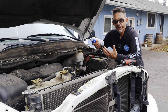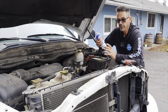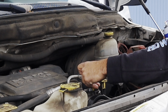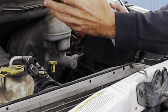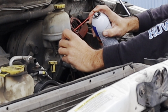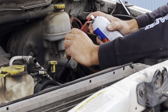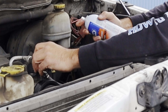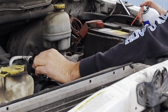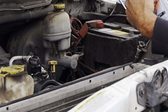Now that the battery is disconnected, unplug the connector you want to work on. I'm using the contact cleaner here — this stuff works great. It doesn't harm plastic and it evaporates really fast. Right here I'm working on the pressure sensor for the AC system. It's very common for oils from leaking cars to get on the connectors. I like to use a straw and just spray it on there to help get rid of all that grease and grime. Let it dry out — you can use compressed air as well. Once it's dried thoroughly, plug it back in and clean both sides of the connector.